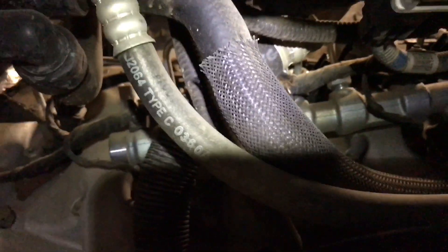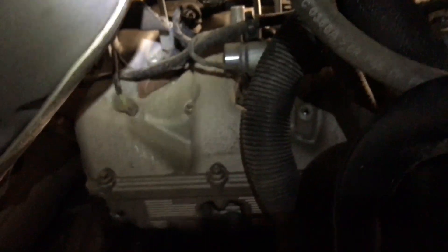Mine does still have the piece on it. Turn that to the left to undo it — there's another one over here. Undo those two and we're going to get that piece of material off, then we'll have access to where the glow plugs are. That piece was in there really tight because of this hose right here — had to pull back just a little bit, but got it out.